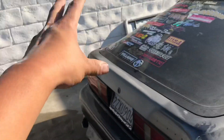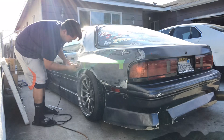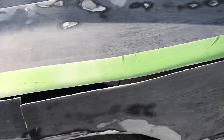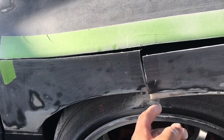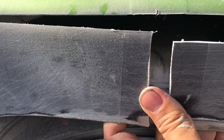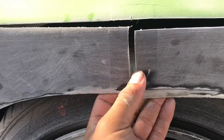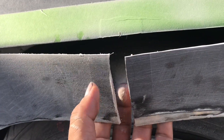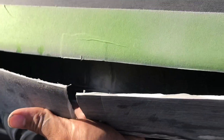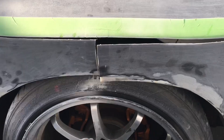That's as far as I want to get on this side — I'm going to start working on the other side so you guys can have a better idea of what I was talking about. I cut this slit here so I can pull it out, cut this slit down the middle so it can separate, and just like the other side you put a little gap there. I put a three quarter inch gap, measured it out so both sides end up being even. Three quarter inch gap, pull it out — I put a little plate here with rivets to hold it straight so it's not like a point — and that's what makes it wider. Then cut the slits down here and pull these up.